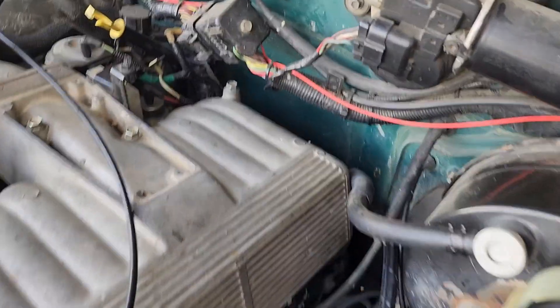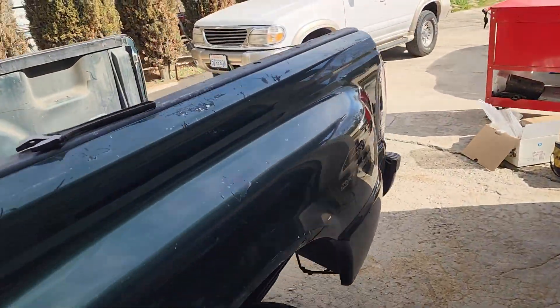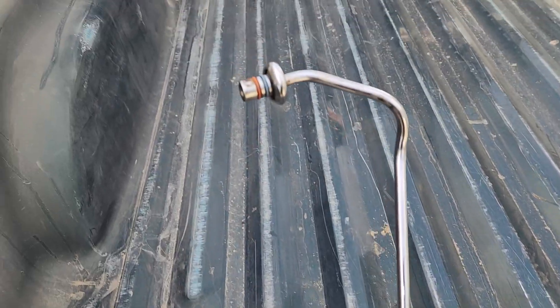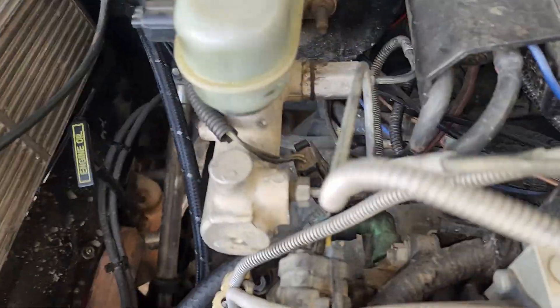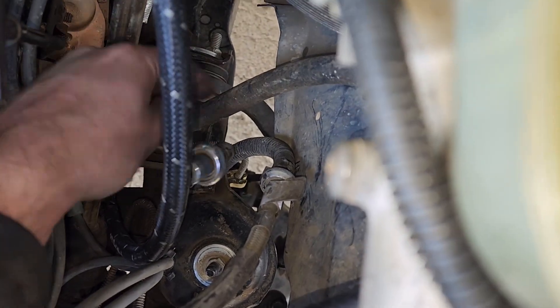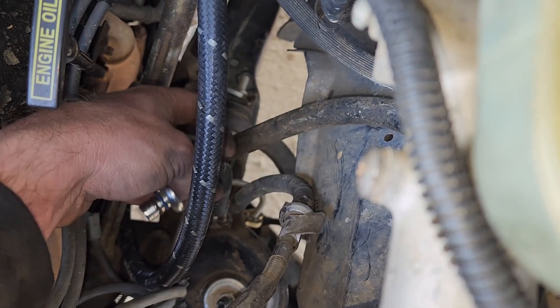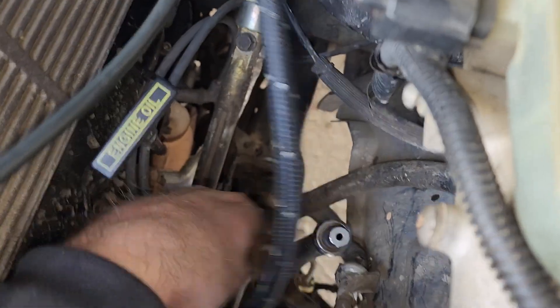So the fuel line upgrade is almost complete. I've removed the old fuel line — this is the supply line that goes on the frame side. I'm removing this entire section of the supply line. One of the main problems I was having is the fuel lines where they come up from the frame right here — this line was kinked, and because of that it was losing fuel pressure. So I'm completely bypassing this entire section of line because it's damaged with this new line. I just have to make a couple of brackets — one to keep it away from the firewall, and another to keep it away from my steering shaft.